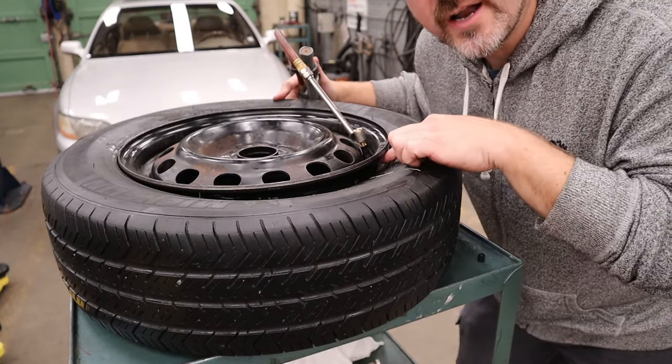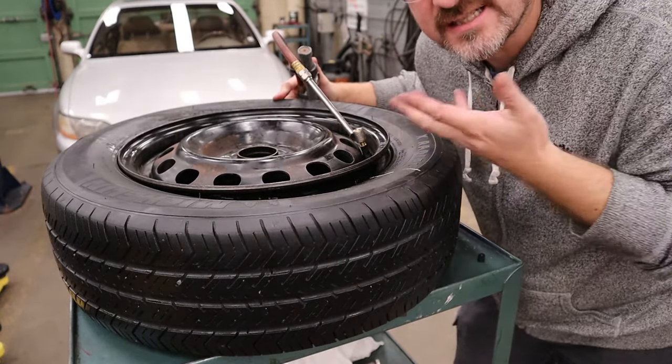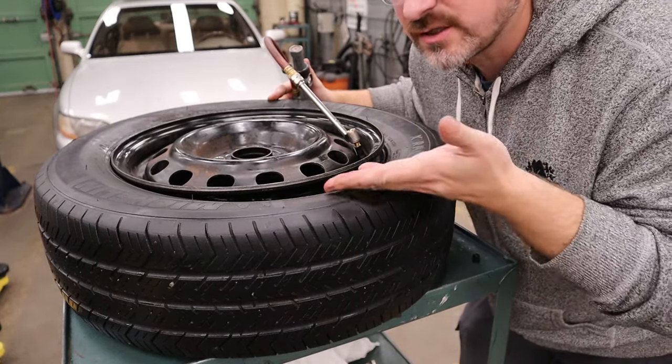A really common problem when you go to put air in is there's too big a gap and all the air is escaping rather than making the tire expand out, seal, and come up to pressure. What you do is put your hand along the tire to find where the biggest leak is, then push against the tire and the rim to close up that gap — it doesn't have to be perfect, just enough to slow the air. As soon as it starts to move you know you've made your seal and you just keep going. That loud pop was the seal, so now we just go to pressure.